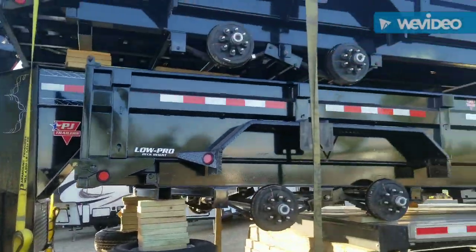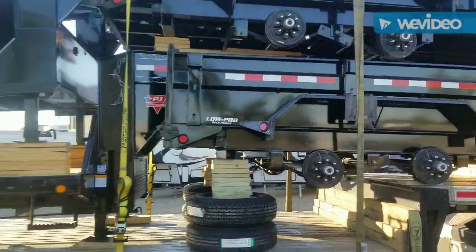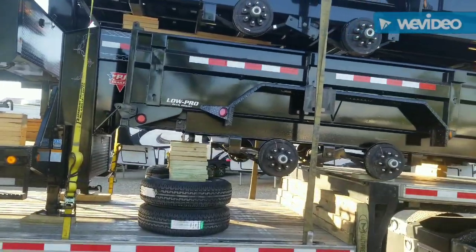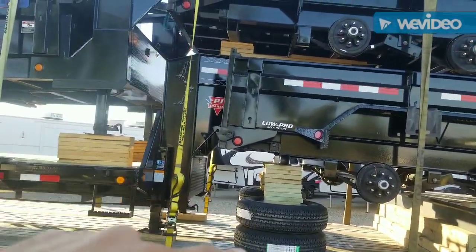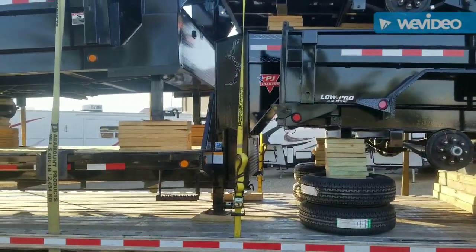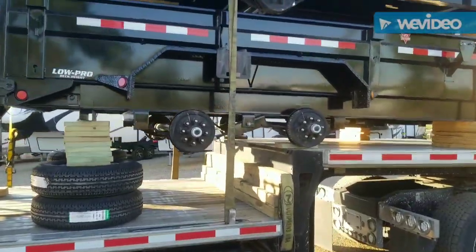Now on the other trailers that I haul, when they're all small utility trailers, all I do is I have 4 2-inch straps per stack. You'll have maybe a stack of 5, 4 high, 5 high, whatever, and I put a strap on each corner of the very top trailer and strap it down, so you have 4 straps per stack, and the trailers absolutely do not go anywhere.